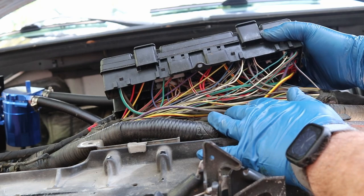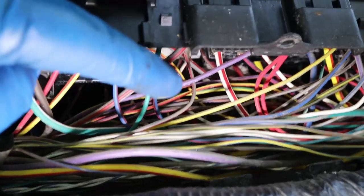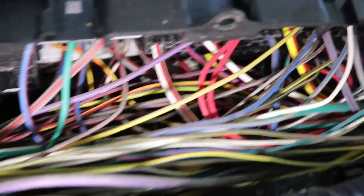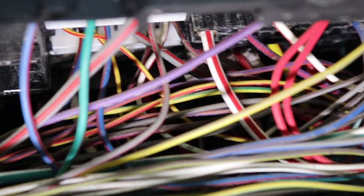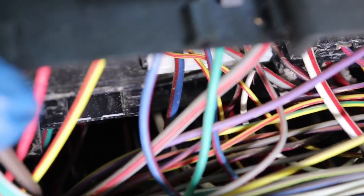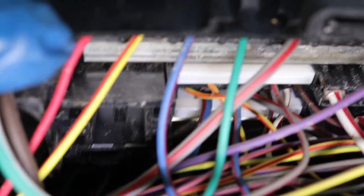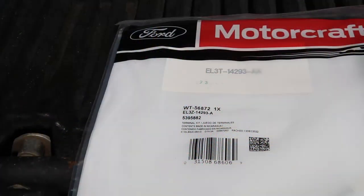Now that you've done all that, you should be able to lift it up where you can see all the wires. Take note: this first row of wires going to the J-case fuses are a lot thicker, and the ones behind going to the mini fuses are a lot smaller — except for the one that goes to the fuel pump. It's like Ford knew they should have put this in a J-case fuse and chose not to. We want that blue and red one right back there — it's going to be the second one from the bottom, after the red and yellow.